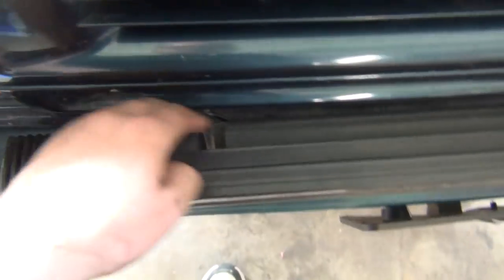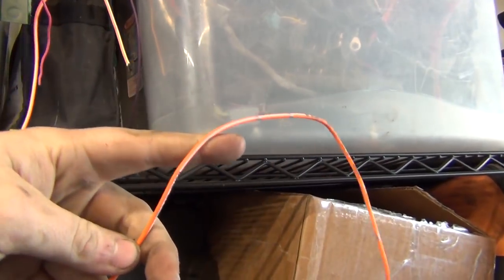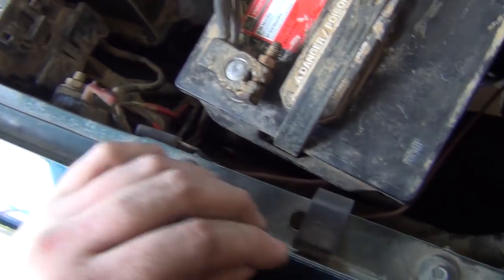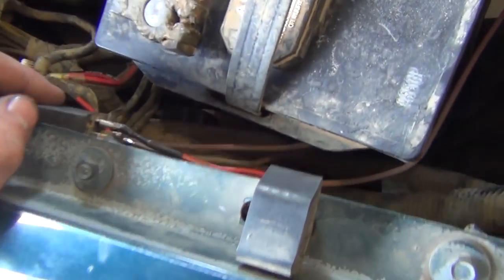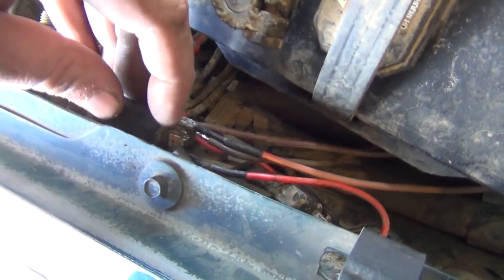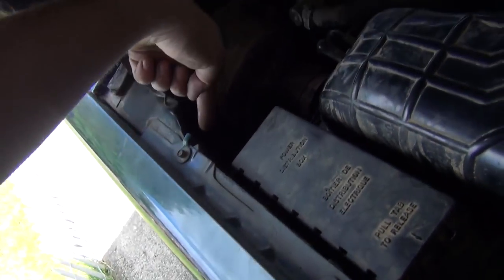So check it out — I've got all my wires for this tied together. I used to tie the lights together because they run a small gauge wire. This size wire is the same, or just a hair bigger than what these have, so that joins them together. And then I run 12 gauge as the main feed. So far the only rat's nest I've got going is just my old light bar relay, but this hasn't given me any problems. I might wrap this up again later. Light bar there is wired up. This is my trigger wire — I just gotta put a connector on there and loop it back over here, and then it'll run down to the main harness.